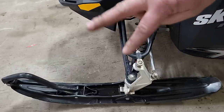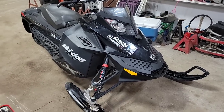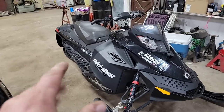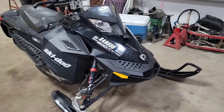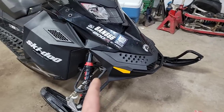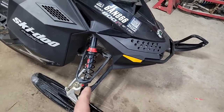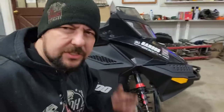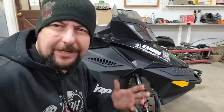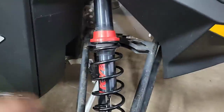This one's supposed to be the easy one — just a quick tune-up and something wrong with the suspension. He was saying she was pretty soft. I'm already noticing these front shocks — they've got the fancy KYBs on here. There's supposed to be a collar under here with level settings, like one to four or whatever, and these things are screwed all the way past the one, which means they're set super soft.